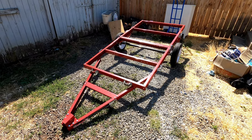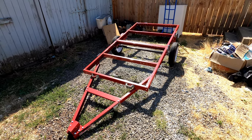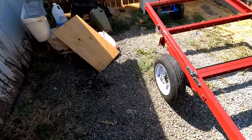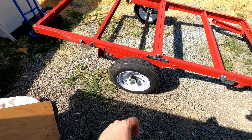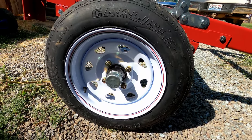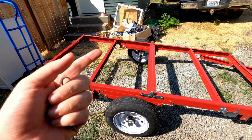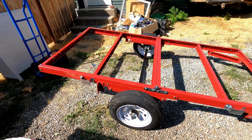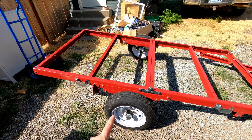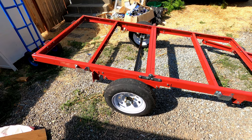It's the next day. I got most of the trailer put together. I didn't film the rest of it because it was getting dark and I'm on a bit of a time crunch to get this buttoned up so I can take it on my trip this weekend. I got the axle in, wheels on, and wheel bearings greased. I did get those spring-loaded dust caps, but if you notice they're not on there — I bought the wrong size. I assumed they were the same brand as the trailer from Harbor Freight, but I guess you know what they say about assuming. So I've got to return those and put the original dust caps back on, filled them with grease and pumped them up real good.